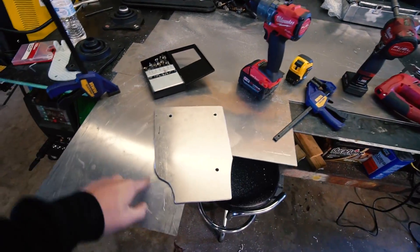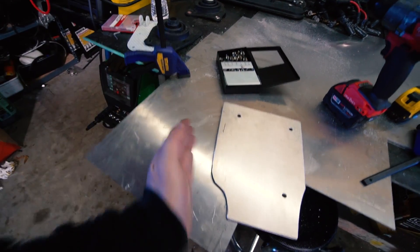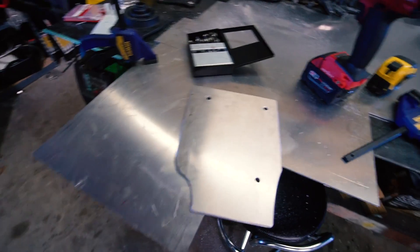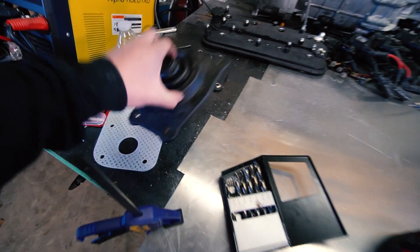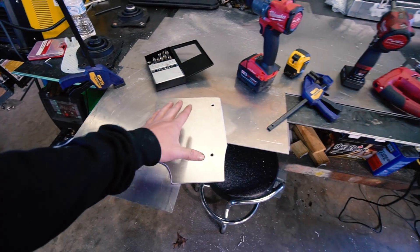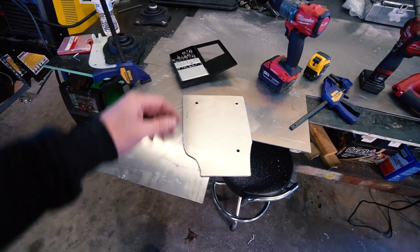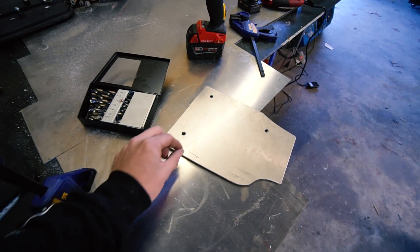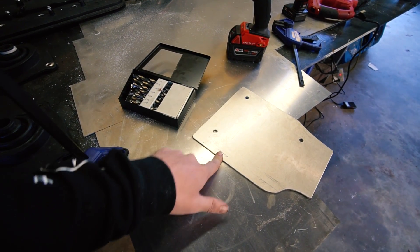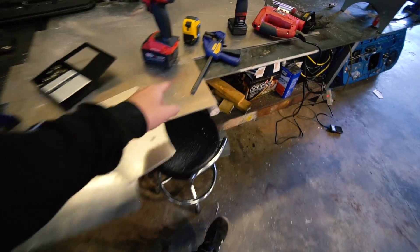Okay, main plate shape is cut and cleaned up to match the edges — way easier than trying to measure and draw all these little curves. Holes lined up perfect because I used the shift boot and measured how far over this hole started, evened it up, drilled the holes. The main base of the plate is essentially done; we still need to cut the shifter hole. Sat in the car and figured out where I want the handle to be both aesthetically and within reach. My thoughts for the handle are to cut strips and weld three of them together so it ends up being about that thick — more welding practice out of aluminum, and it should be sturdy.